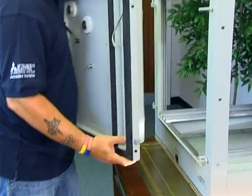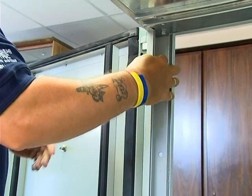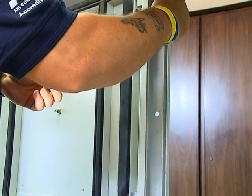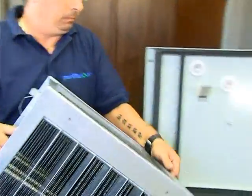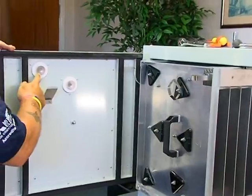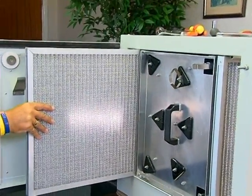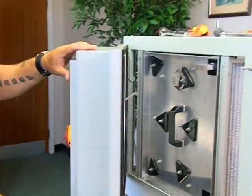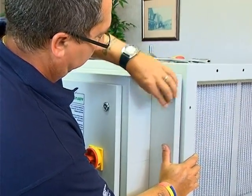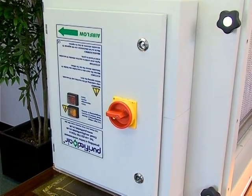You can now rehang the door. When you've rehung the door, it will appear upside down due to the orientation of the sticker. Reattach the earth wire that connects the door to the body of the machine using the 7mm nut driver. Put the collector and pre-and-after filter components back into the unit and ensure the contacts line up. Check that the threaded rods line up with the holes in the door for the compression locks.